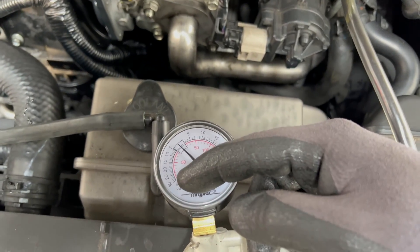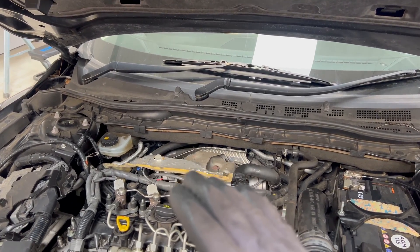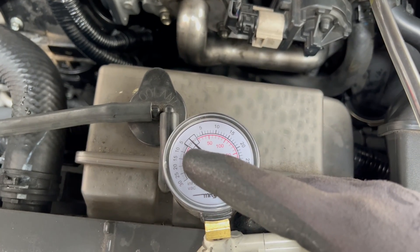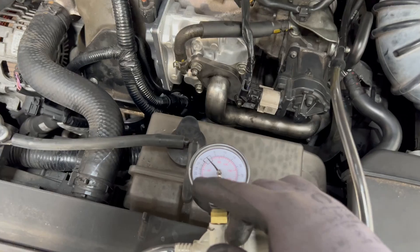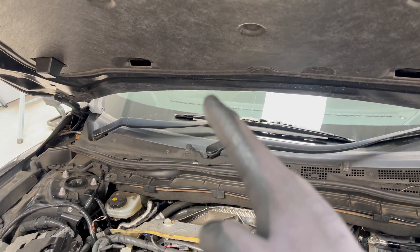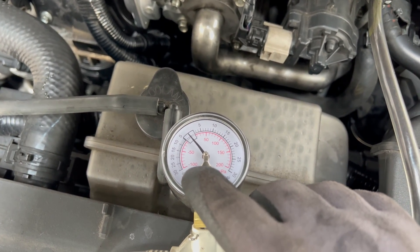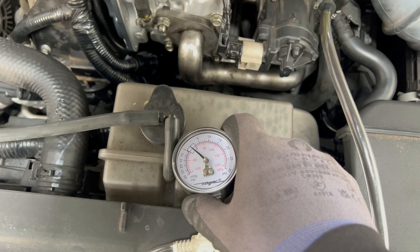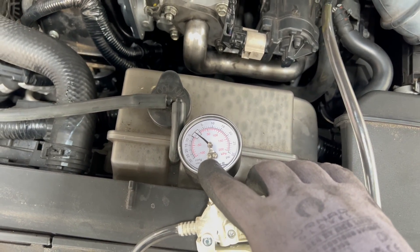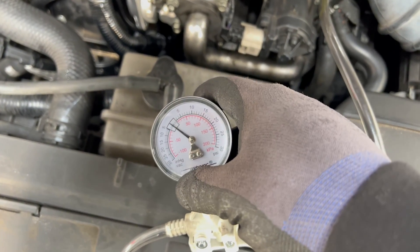Once we're at that point, he's going to press the brake a lot of times and we don't want it to go back to zero, because zero is 100 on the live data. I may try to show it on the live data at the same time on the gauge. When he applies the brake, on the live data it shows rising numbers, and on the gauge it's also rising numbers — from minus 100 toward zero — because the maximum vacuum possible on earth is minus one atmosphere.